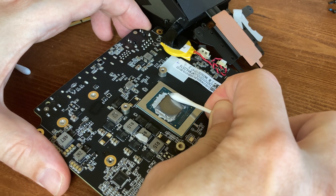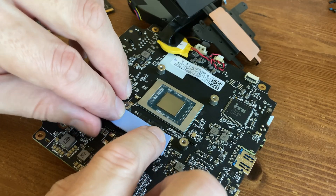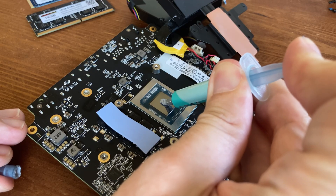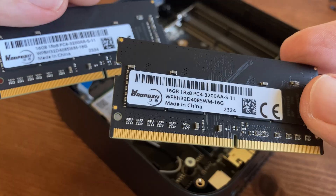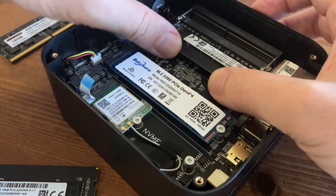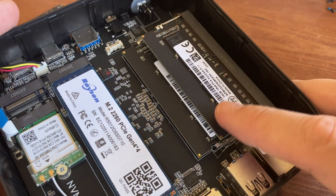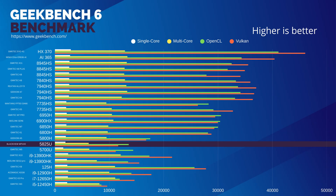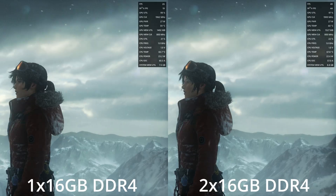Let's clean this up. We'll apply a new, slightly thicker thermal pad and a fresh coat of MX6 thermal paste. We'll also switch out the single stick of memory for two sticks, giving us dual channel memory — and this should speed things up a lot. The improvement is due to dual channel rather than just the extra memory capacity. In both Geekbench and Timespy, the gains are significant — it's almost as quick as the 5800H, albeit much more power efficient. Now we can see the true potential of this chipset.